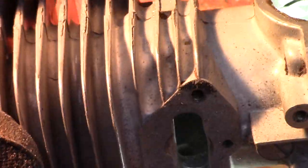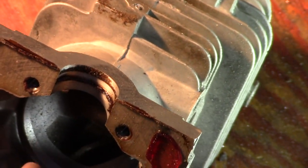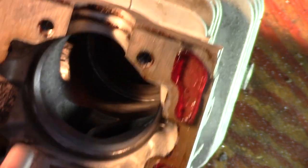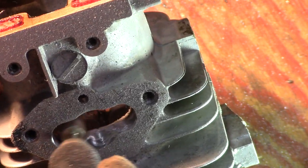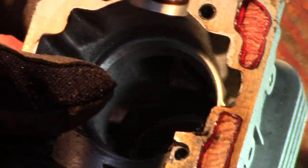All right guys, that cleaned up the intake. Now we do have the transfers right down there — I could try to open it up to the bottom of the crankcase but I think I'm going to leave that for now. I'm just going to see how much more this gives me, and if I ever need to go in here again I can do it little by little and see what kind of performance gains I have.